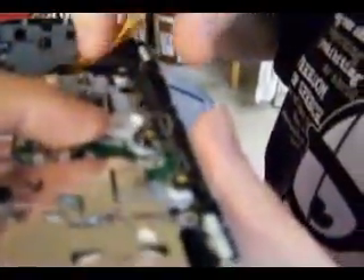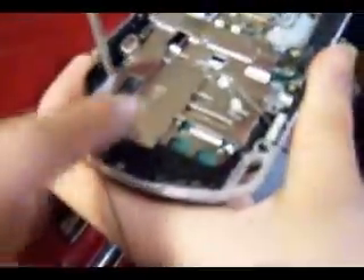So this is basically the deepest part of the whole PSP. This right here controls the system clock. And this is the standard connector — you can actually get a simple cable to plug that port right there to your computer's USB. That will allow you to put movies and MP3s on it. You have to do that if you want to put protected music files on it — DRM files have to go through there.